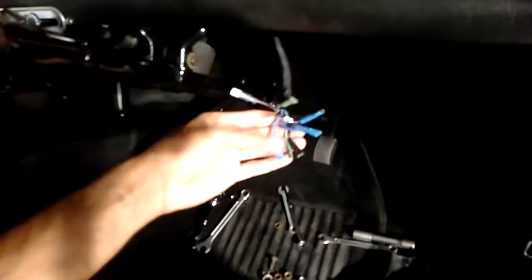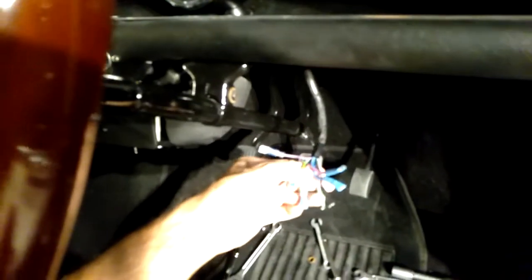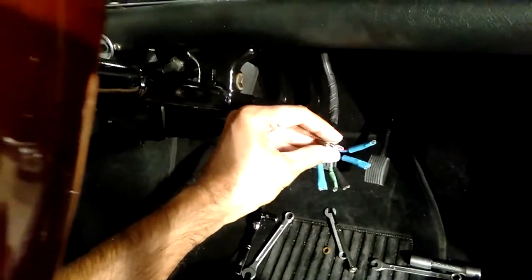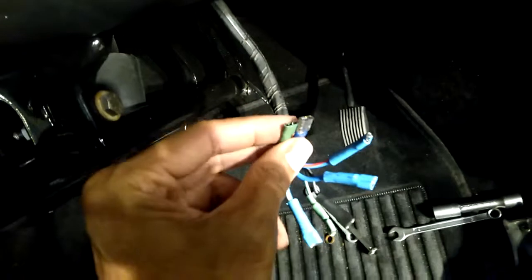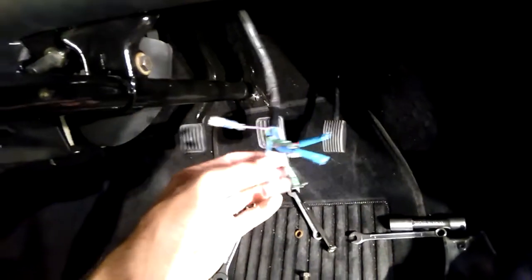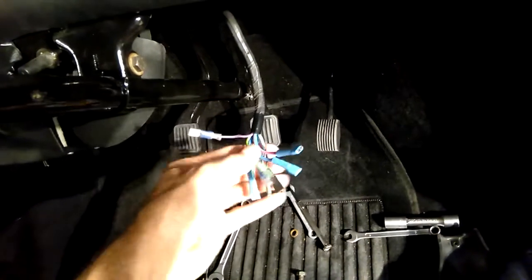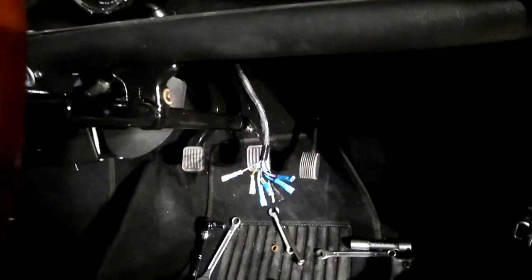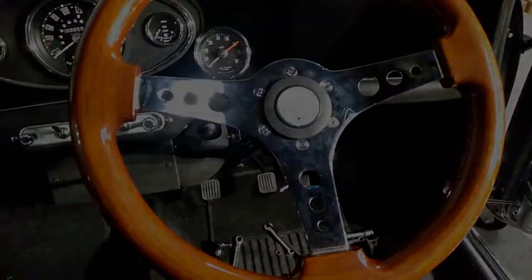So that is all fine, because I thought there might have been an issue with this wiring, and when they were in that loom they were sort of touching side by side, but with all the heat shrinking on there, that insulates them all, so that wasn't the issue. It's just the actual switch. Alright, so I'll get this bolted in and then we'll catch up again tomorrow.